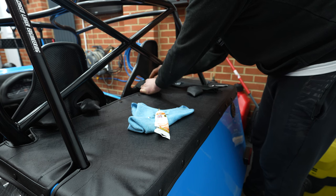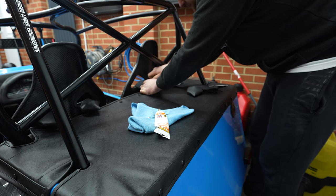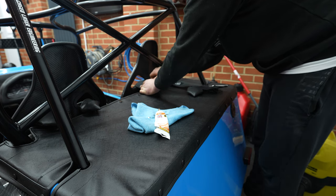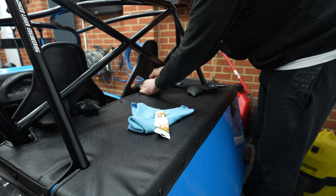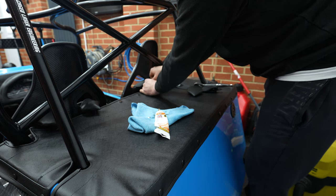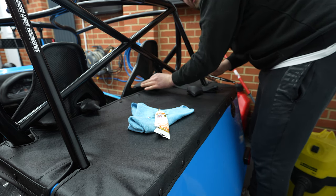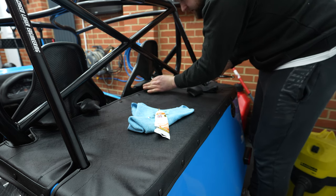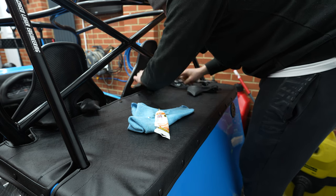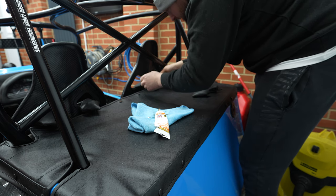And that's a 17mm. Bolts are provided by MK. They come with the seat belts because they're specific harnesses. Thread, yeah. They are 7/16 UNF, which is the seat belt requirement, or seat belt standard as such. But it's always worth tapping these because these were a bit manky in the thread, but now you can see it's literally lovely. All the way in by hand. And then nip them.